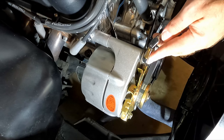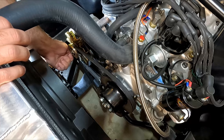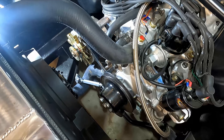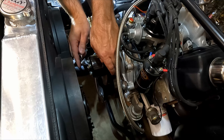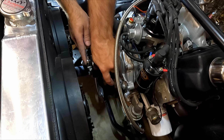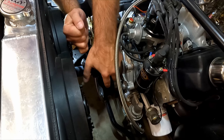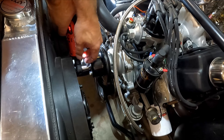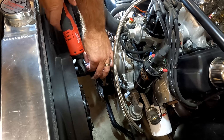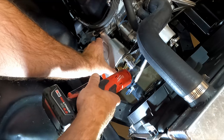You have a 5/8 on this one to get it loosened up. Now we can finish taking this out at the bottom — now this is loose, get the belt off. This takes a half-inch wrench to get these four bolts loose. Pro tip: it probably would have been easier to get these loose with the belt still in place, because it holds the pulley in place. Let's finish getting the alternator out of the way.